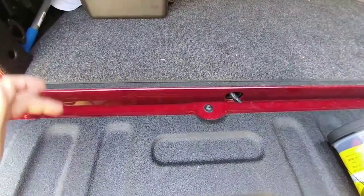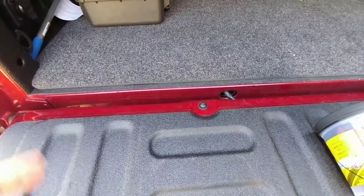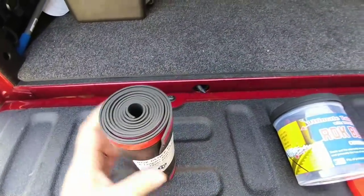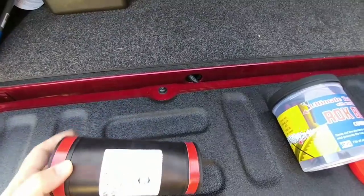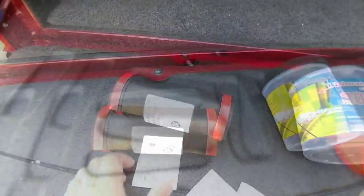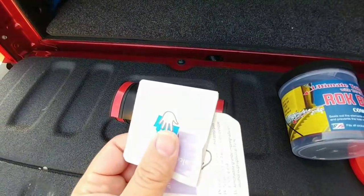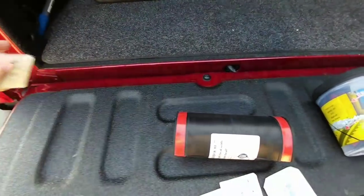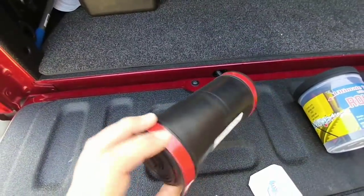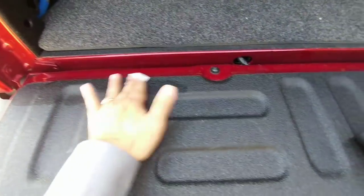The instructions first say that you have to wash and dry your bed as well as your tailgate, which I did about a day and a half ago, and then gave it time to not only air dry but to fully evaporate. This Rock Block XL kit has 3M adhesive tape on it, and this is really good stuff, but if you don't prep your tailgate correctly it's not going to stick. Included in the package is an adhesion promoter — you get two packs of that — plus three packs of alcohol wipes. First, use these alcohol prep pads to clean the surface where you're going to apply your adhesion promoter and ultimately tape down your tailgate seal.